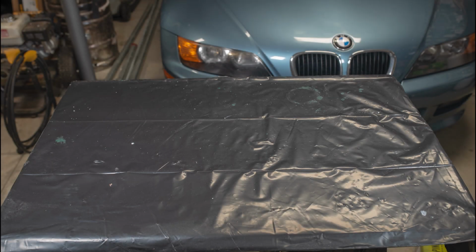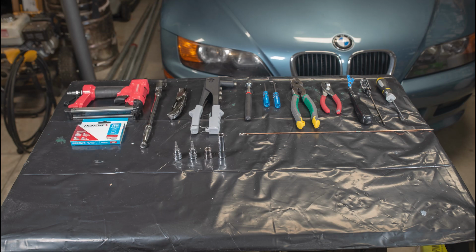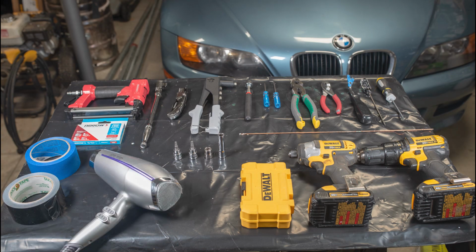In order to do this job properly, I'd recommend you have the following tools in your arsenal: a T25 and a T30 socket, 10mm sockets, a deep socket is a must, Phillips and flathead screwdrivers, a door trim panel remover, assorted pliers, an awl or some sort of pick, a magnetic telescoping pickup tool, a length of rigid wire like brazing rod or TIG rod, a pop rivet tool, a sharp knife or razor blade, a socket wrench, a staple gun, 10mm T50 stainless steel staples, an impact driver and/or a drill, some drill bits, blue painter's tape and duct tape, a hair dryer or a heat gun. I'll leave links to where you can purchase these tools in the description below.